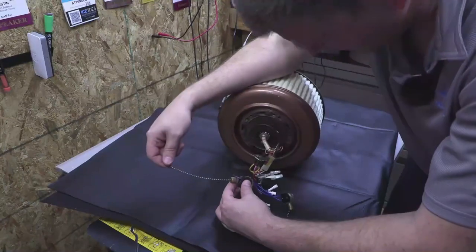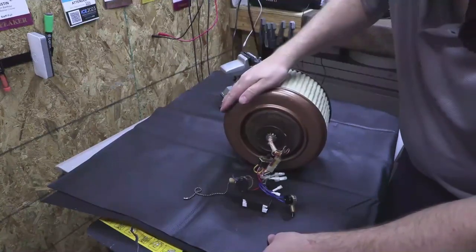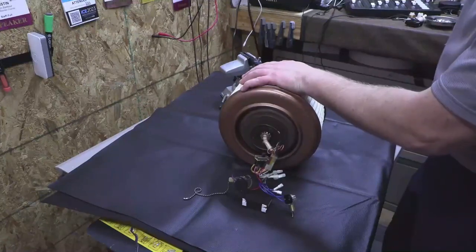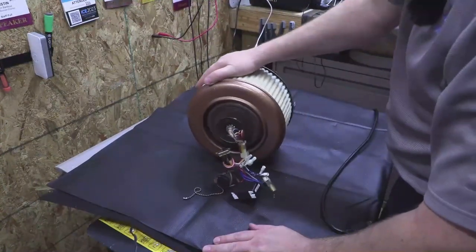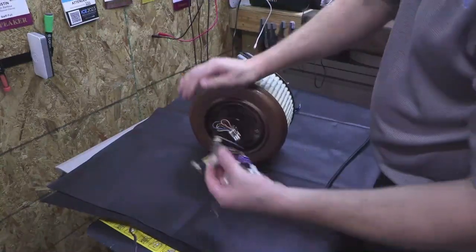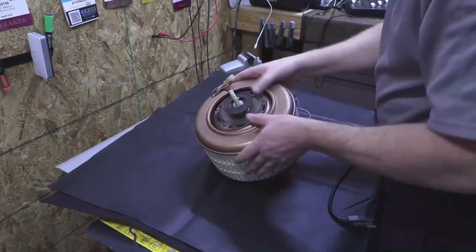It's kind of loud. I don't think it's rubbing on anything — could just be the bearings, but it's also completely free-loading without blades. Right now that should be maximum speed right there. It's not grounded — I'm touching it and I'm not getting zapped, so I guess that's a good thing. This unit is functioning. Go ahead and unplug it — remember, AC motors that are spinning still generate electricity, so do not touch the wires while it's still spinning.